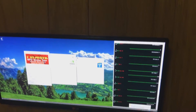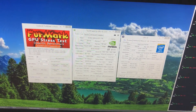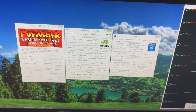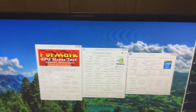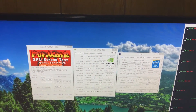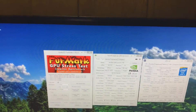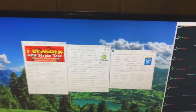I have two monitors: a 1080p panel and a 2560 by 1080 ultrawide panel. I couldn't get 99–100% GPU usage on the 1080p panel because the CPU was being bottlenecked — FurMark uses two cores and pegs them at 100%. So I increased the resolution slightly with the backup display to get close to 100% GPU usage and draw maximum power.